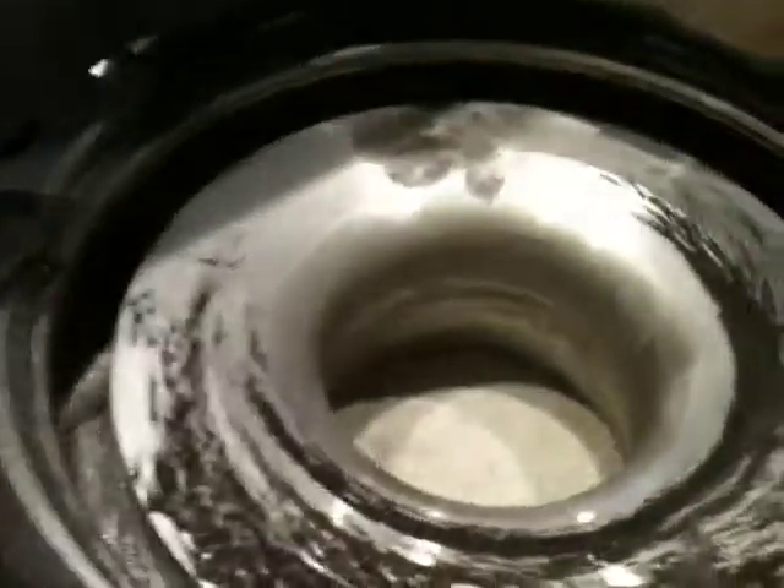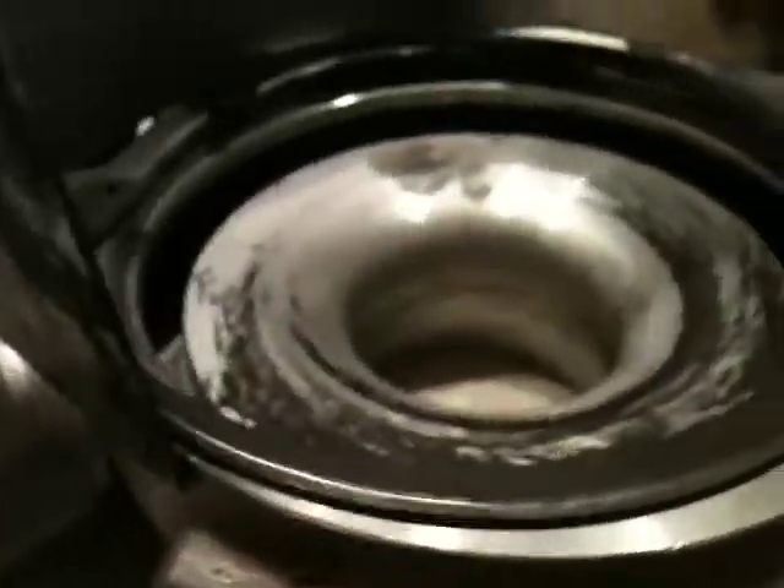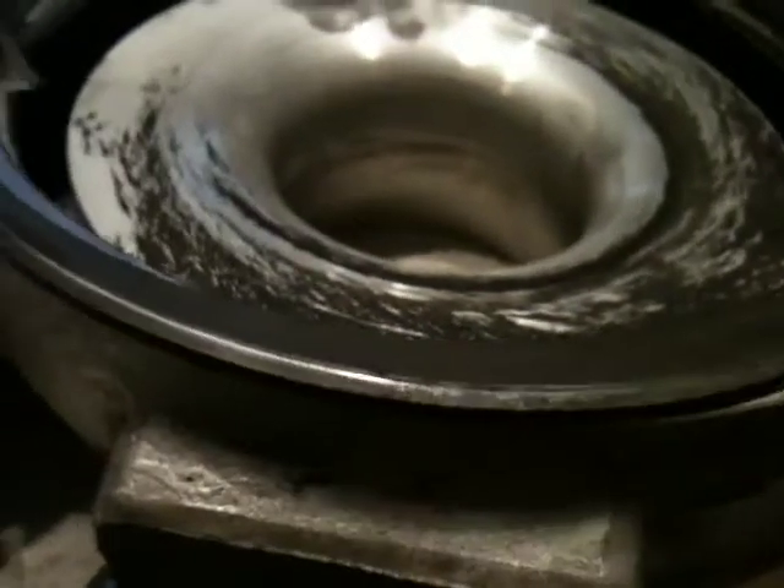The next thing I'm going to do before I reassemble everything is just do some cleaning with some brake parts cleaner, get this intake housing a little bit cleaner. I'm not sure if you can see down in there, but there's a bunch of CDR blow-by, some old oil and crap like that everywhere. I'm going to clean that up as best I can, and also clean in this groove here where the snap ring goes for the intake housing, and clean your snap ring for the intake housing just so that it makes good contact.